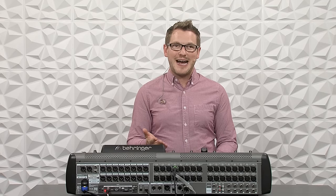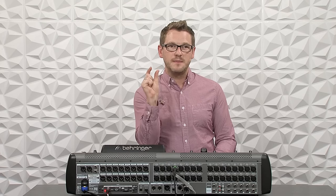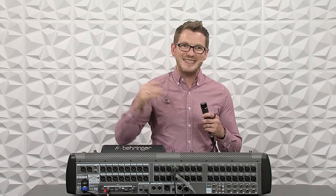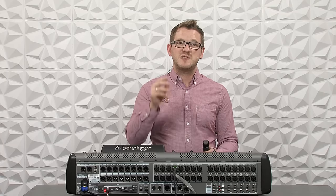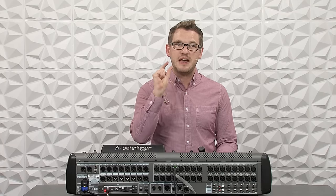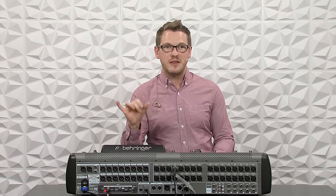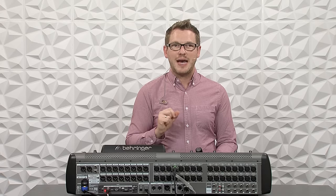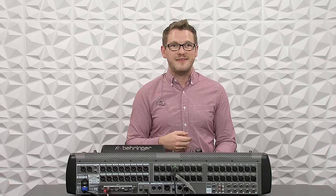Now, the reason that I add this delay is so that feedback takes a little bit longer to appear. Because of that distance or that latency, any feedback won't spike right away. It will take a little bit longer and it'll ring out just a little bit longer as well, making it so that I have a little bit more time to either A, identify the frequency, or B, go and find the EQ adjustment to bring that down.